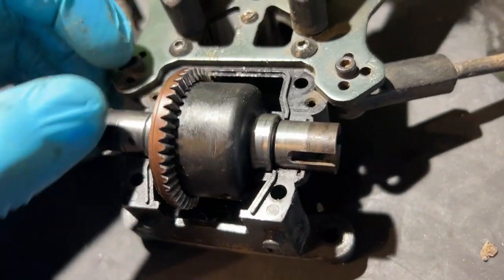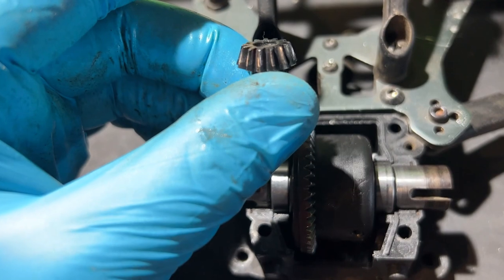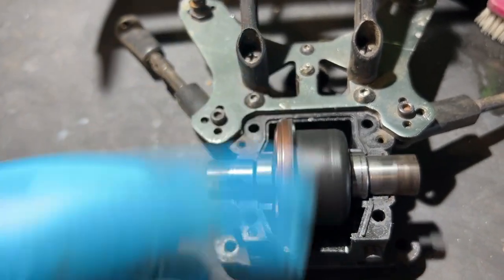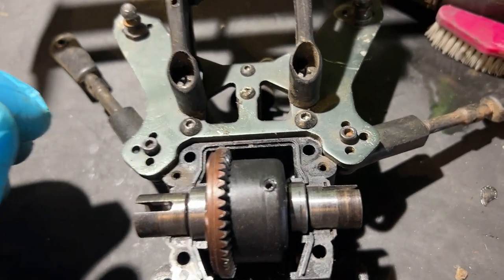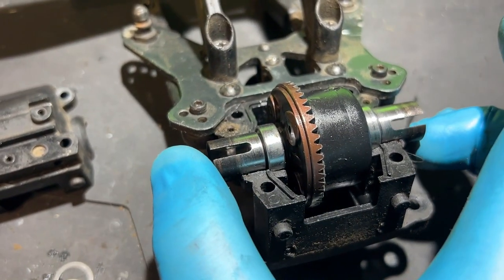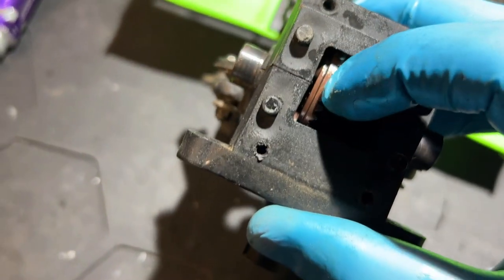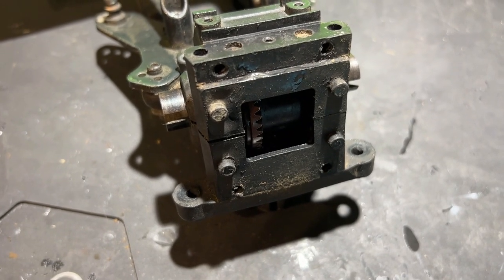I've got it cleaned up and it doesn't really look too bad. These are brand new bearings in the whole rear, and that looks okay to be honest. I think it's a shimming issue — I think it needs another shim on this side to push it a bit closer to the pinion gear. On the front end I replaced the whole bulkhead and that came together really nicely without needing any shims because it's a brand new bulkhead. So I'm going to shim it, put it back together, and see how it performs. With the additional shim there's now zero side-to-side play, and when I spin it over it feels nice and smooth. I put the case back on and it's just got the tiniest bit of movement, taking all the play out, so we'll grease it up and put it back together.